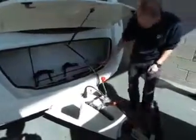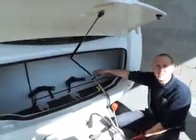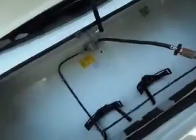Yep. Okay, gas locker. On your previous one, you may have had a regulator attached to the actual bottle. This one is attached to the caravan. You can see that there. You can operate butane or propane off that particular regulator.